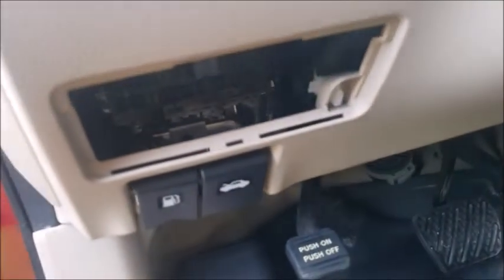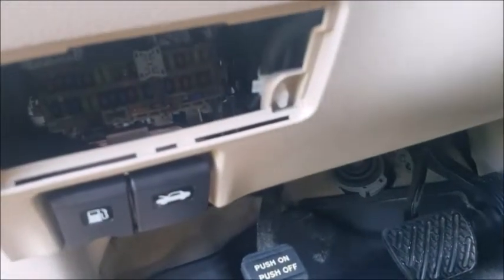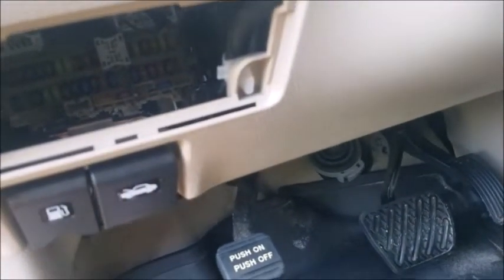What you're going to do is take your needle-nose pliers and look for the row. This specific row is number seven, so I just count down. It's on the top row, and as you can see there, number seven is the cigar lighter. So you count: one, two, three, four, five, six, seven.